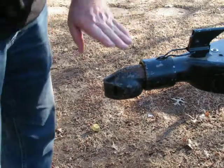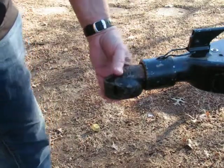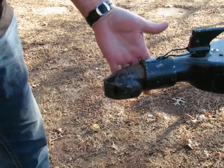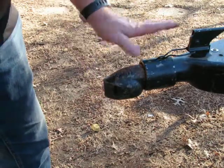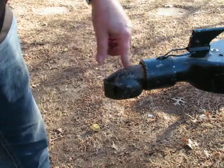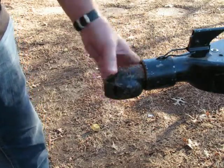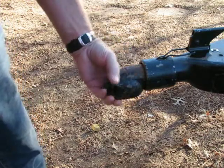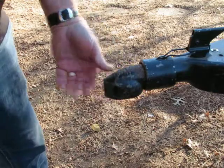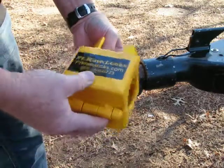This is a very common coupler on utility trailers and work trailers. It's a bulldog — not to be confused with a similar one called a ram. The ram has a more angular, diamond-shaped head, while the bulldog has more of an egg-shaped head. This coupler fits both the two-inch and the two-and-five-sixteenths versions.